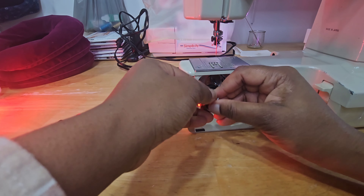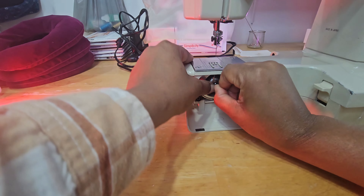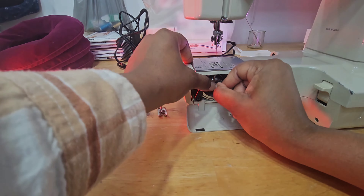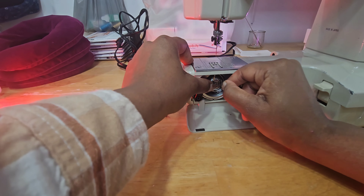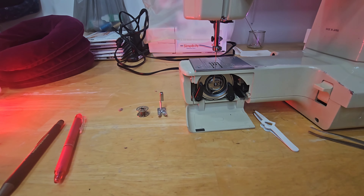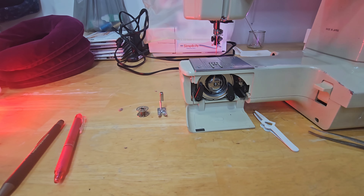The shuttle is in there, but if you don't have that bobbin seated correctly — it has to go in there and click, and then it can't turn. See, it's in there and it's not turning. Let the lever go — now everything is operating well. I'm going to have to change my needle now because I think I've got a little bend in it and I don't want to cause any problems. Alright, that is how you clean your shuttle area — thanks for watching!